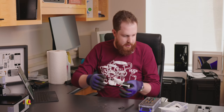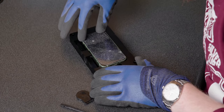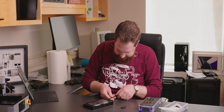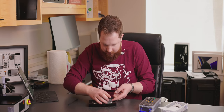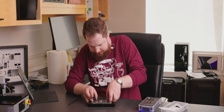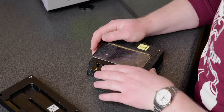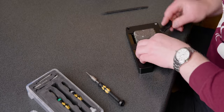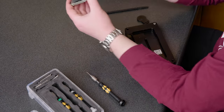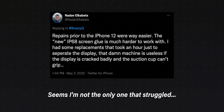We place it into our new mold — wow, that's extremely tight and nice. Now I have to get the top adhesive off. I slide the bottom of the phone towards me slightly and insert the edge of the adhesive cutter. This is not hot at all, so that thing must not get too toasty. It is completely stuck — just not hot enough. Taking a creative liberty on the manual, the display is pretty much chowdered. I've actually delaminated the OLED from the frame a little bit. The heat press just doesn't quite heat everything up enough, but finally I do have access and everything seems to be intact.